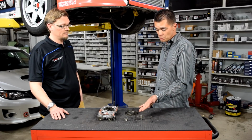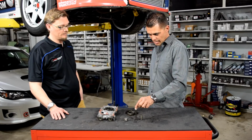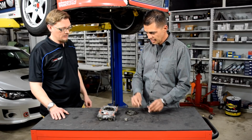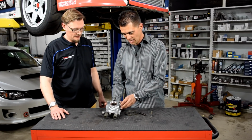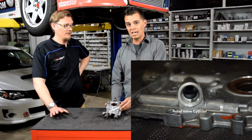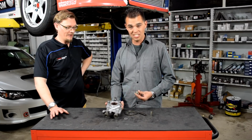So that was my first experiment on trying the shim. Right. So we took the 10 millimeter pump and we basically took two of these, dropped two of them in here, put them back in, and for those who are familiar with this, the access port for this is actually right here. It's on the front, and you actually have to remove the entire front of the motor, the timing belt, the cover, the pulley, the whole works, just to do this 30-second operation.